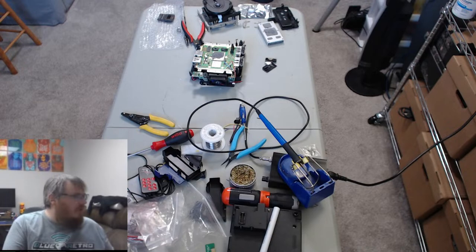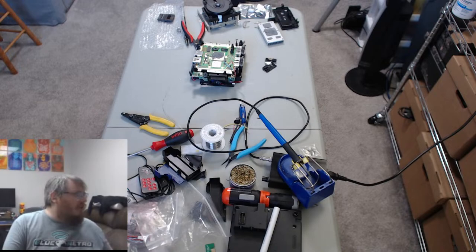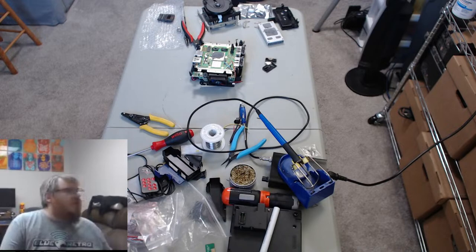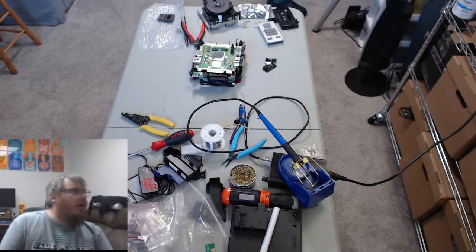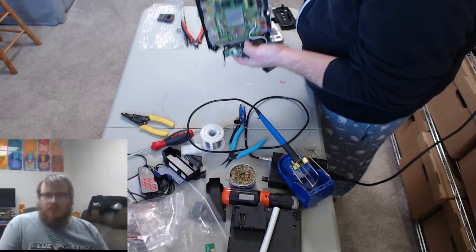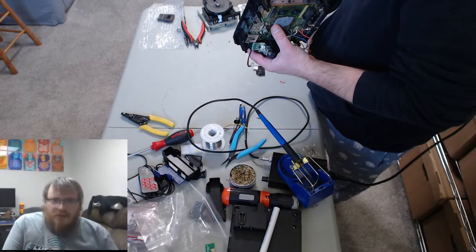So I download the full version of Swiss and extract it, right? Not the end kit. Yeah, you download the full version of Swiss, and then you're going to, let's see here, the Swiss 14R1400, and then under the DOL, I drag the DOL file, right? Drag the DOL file to the root of the SD card, and then you rename it to IPL.DOL. Gotcha. Okay. So I am going to try installing out there. The side-loading one. So, okay. It's two pieces that I think you have to put together, which I can't tell if you did or not, but...